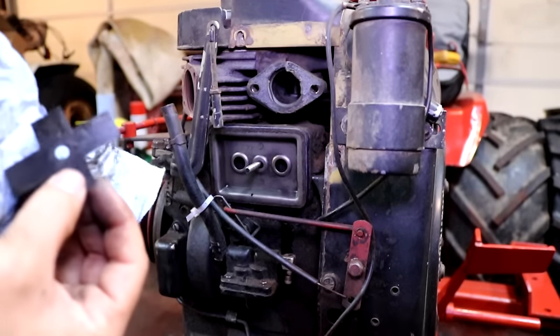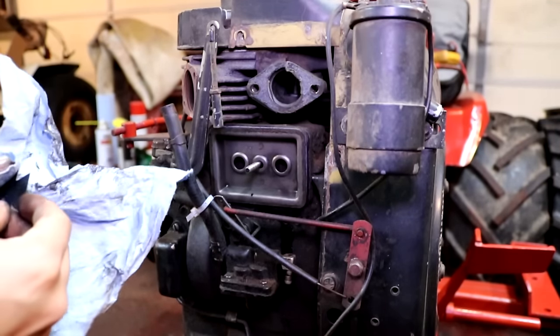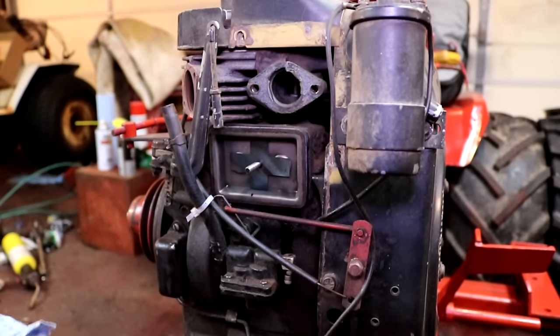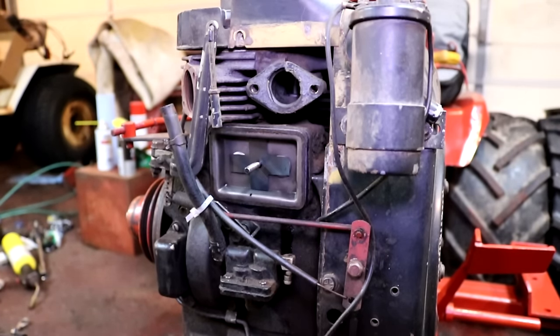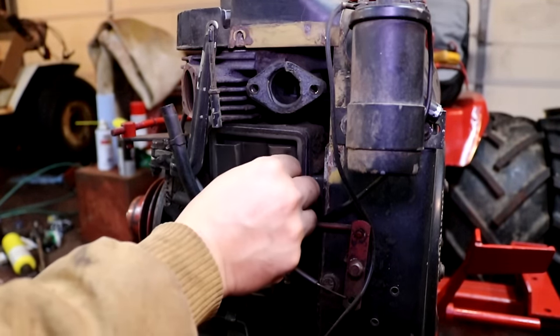This piece right here is a piece of spring metal — this is your reed valve. What this does is it allows crankcase pressure to leave the engine block as the piston is moving down into the crankcase. Yet when the piston goes back up, this reed valve closes and does not allow any pressure to be sucked into the crankcase. This is important — make sure you put this on the correct way. The next plate that goes after it needs to be oriented in such a way where this little reed valve will be able to open and close freely.